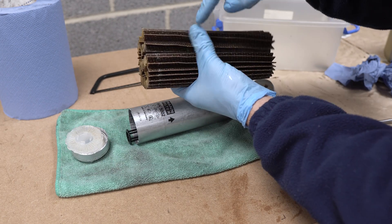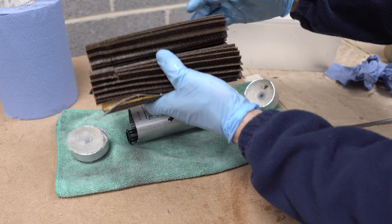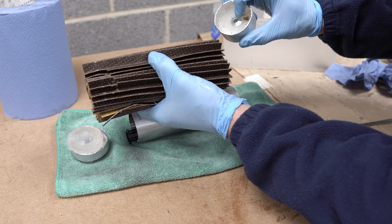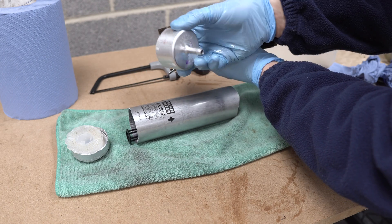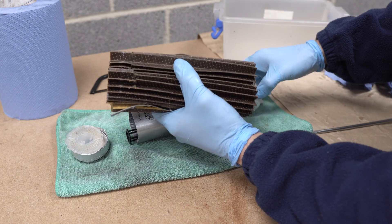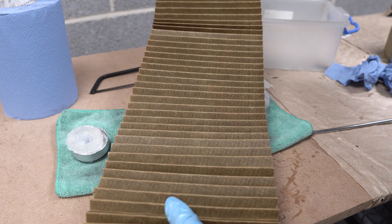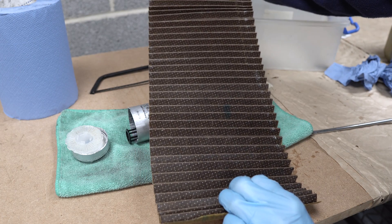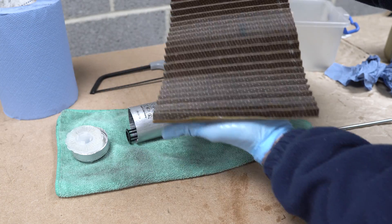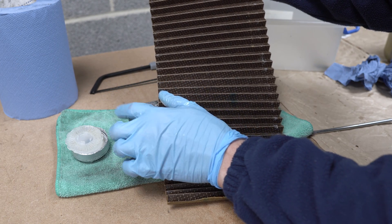The fuel will go to the outside, it will be filtered by the filtering element — this cardboard — it will go to the inside, and it is guided on the outside port and goes to the high pressure fuel pump. This is the inner bit, which is lighter in color, and the outer bit, which is much much darker. The metal filings that we are seeing are from contamination when I've done the cutting.